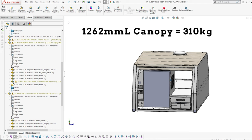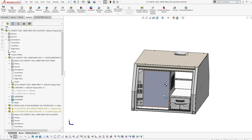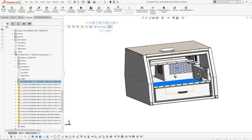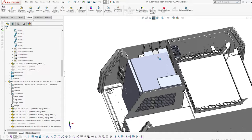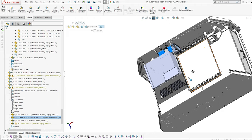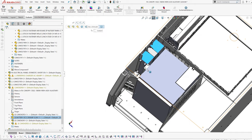I can also bring in the center of mass - highlighting it shows our center of mass is quite far forward, which is good. One thing I haven't touched on is the battery: because this drawer goes all the way to the back, I can't put the battery below the false floor as in the previous build. So we use a different battery - a DCS 200Ah. We make the most of the space next to the fridge by popping the DCS on its side in that section. It's still a 200Ah battery - the weight is further forward but it's offset. A little pro, little con - still a very good setup.